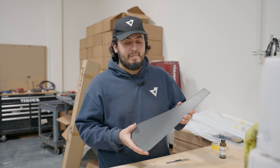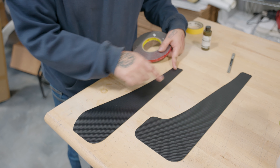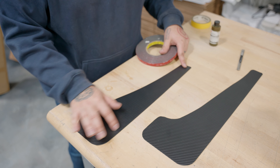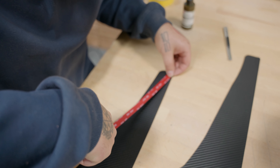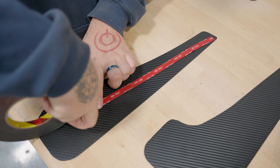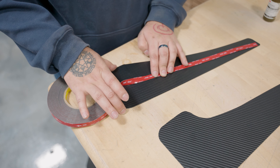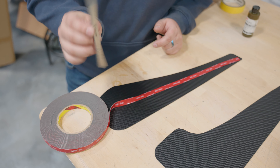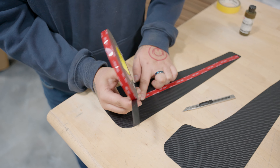Since this is the front, you're not going to put the 3M tape straight down, because then you won't have the section of the mud flap popping out. You have to go at an angle so it can show off the mud flap. We're going to start from the top at an angle, line it up, and for the front one I'm going to stop about right here — because the bottom section of the mud flap hanging off isn't grabbing onto anything. Just give it 3M tape where it attaches to the liner, then cut it right there and peel it off.